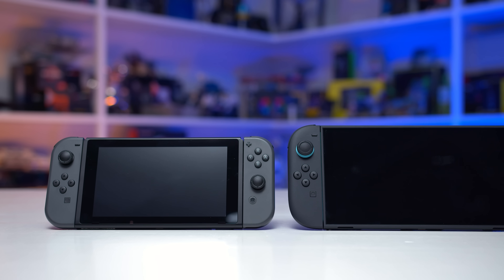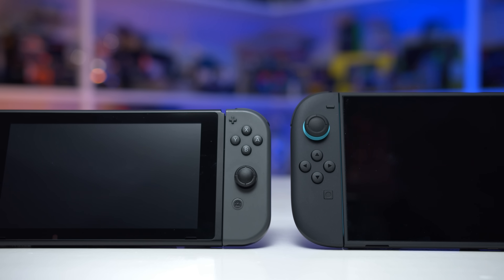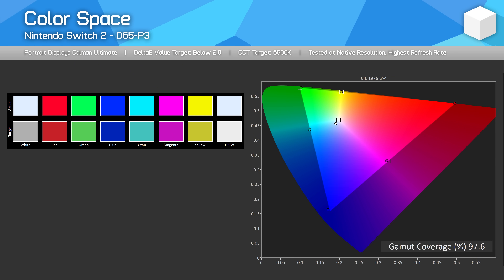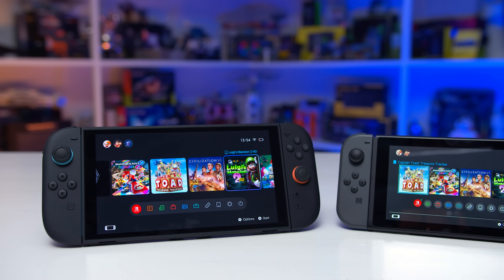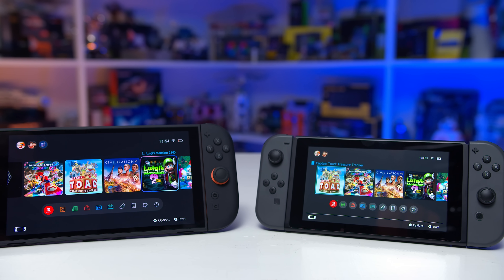The Switch 1's LCD is absolutely horrible at handling ambient light and ends up reflecting a ton of it, often making blacks look grey in all conditions other than pitch black rooms. One of the main improvements from the Switch 1 to Switch 2 LCD outside of size and resolution is support for a wide color gamut — I measured 98% coverage of DCI-P3 on the Switch 2 LCD, compared to 79% on the Switch 1. Both models have full coverage of Rec.709, but that's where the Switch 1's color gamut ends. The Switch 2 extends to P3, which is one of the things a display needs for HDR content. The Switch doesn't appear to perform color management, so Switch 1 games designed for Rec.709 have increased saturation when run on the Switch 2.